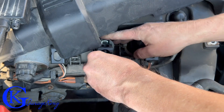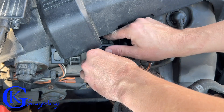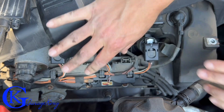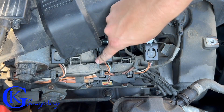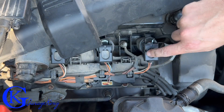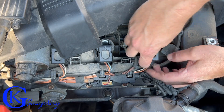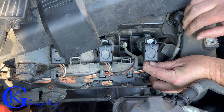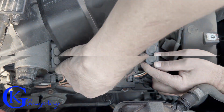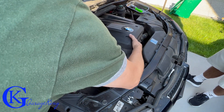You also want to make sure you have a good connection. I turned the cover down and found the harness on one coil wasn't plugged back in — you can actually turn the harnesses down without getting them plugged in. You can see number two is seated correctly with just a very small gap, but look at number one — the gap is too big. I had to lift the cover and give it a firm push to fully seat it. That's really important for a good connection, or you'll just throw more trouble codes. Surprisingly, nothing actually bolts the coil packs down — they're just pushed into place.